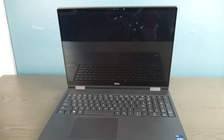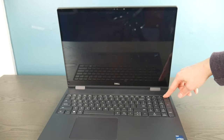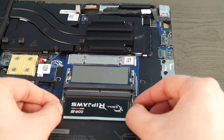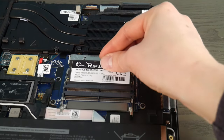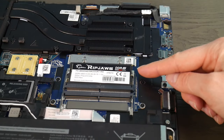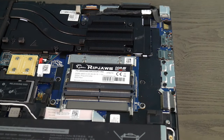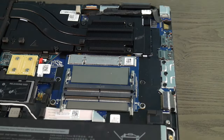If I turn the computer on with one RAM stick removed and it works, then I know the removed stick is bad. I'm testing my second stick of RAM right now. If the computer still doesn't turn on, the next step is to try it in the other port to see if a port is bad. I'd try one stick in the other port and turn on the computer to see if it works. If you only have one stick, try it in both ports, and then the next step would be to buy a brand new stick — same brand, same part number — and try it in both ports.